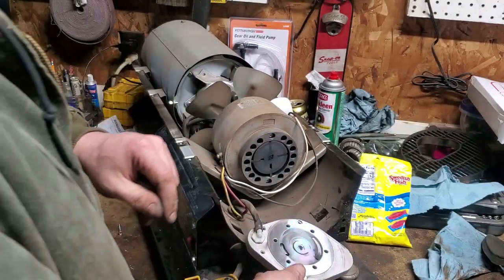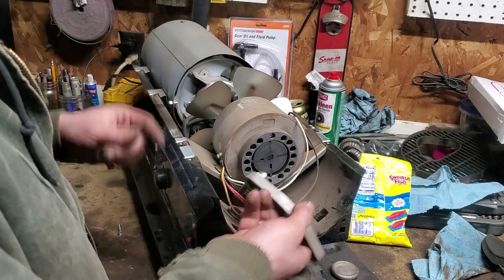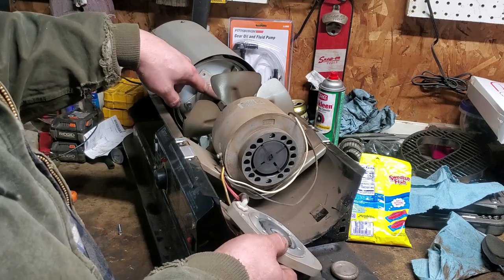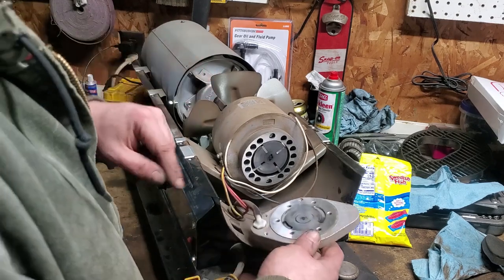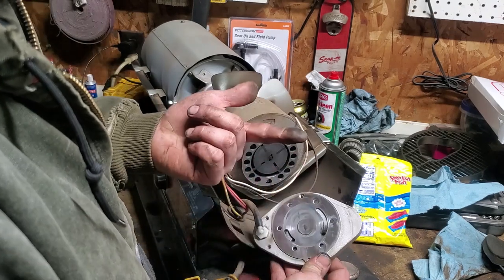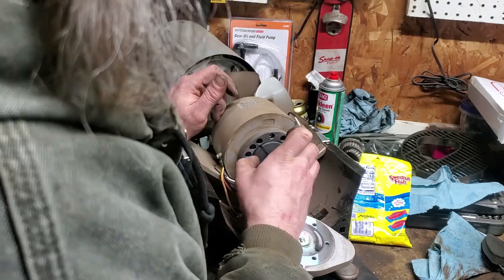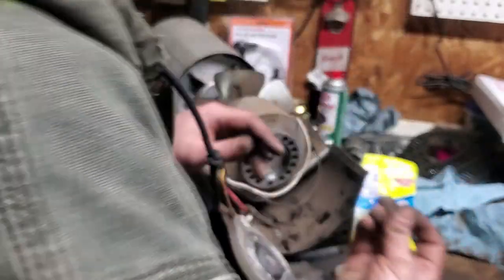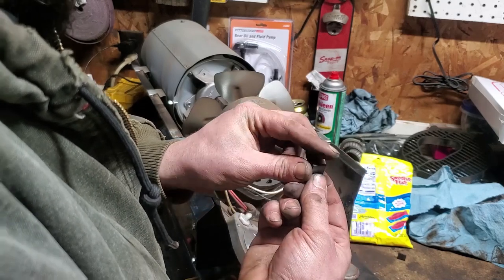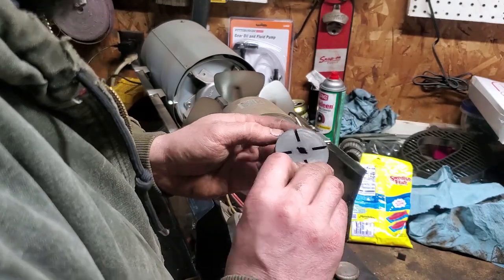Basically you've got air coming in on this side, then a vacuum on the other side, which makes these vanes go down and around, applying a vacuum to the nozzle and drawing fuel out of the tank. As you can see, it's all black and worn in there — she's starting to come apart. In theory you could flip these over and use them again, but I ended up just getting a whole new wheel.